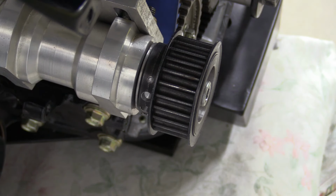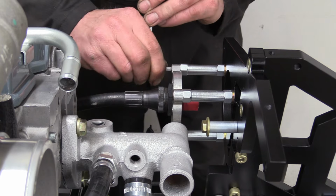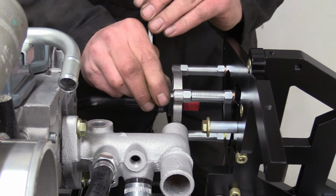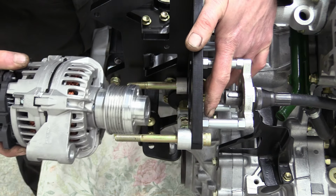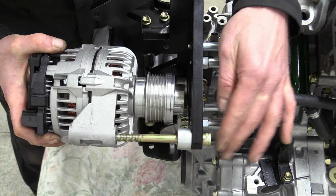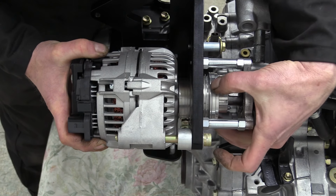We had the whole flexi drive assembly balanced at the same time as the crank, flywheel, front pulley and clutch. We also bought a new uprated alternator, one that puts out a few more amps than the original Rover one, as we're running a few more electrical systems than the ZR did.